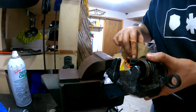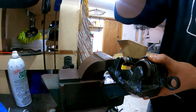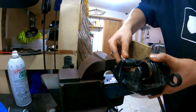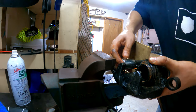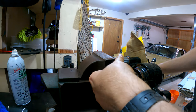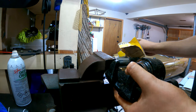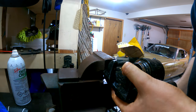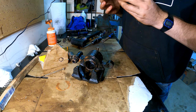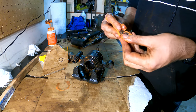I have a little piece of cardboard here to help line things up. You want this thing to be ready to go in. You're going to want to use a 22mm socket. You're going to want to pray that your vise opens wide enough — it does. So the socket is going to go hopefully over the boot — you don't want to push down on the boot, you want to push down on that steel lip. Greasing this all up again — way overkill, I put way too much grease on this.